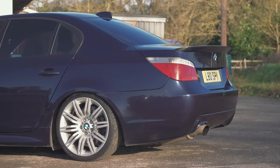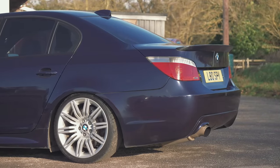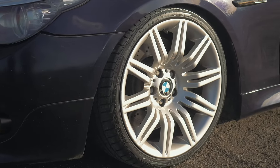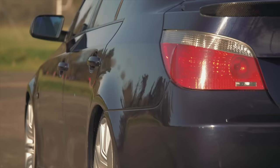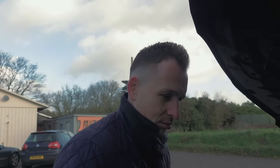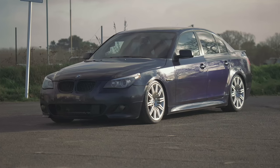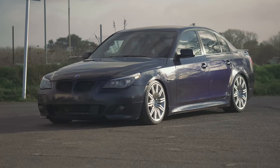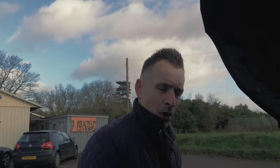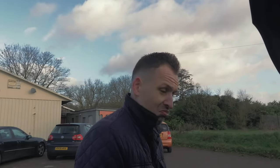Now, what about ECU mapping and stuff like that? So she runs with a standalone ECU, a Link G4 Storm, Yaris coil packs, 850cc injectors, 3 bar map, and then just on the crank, it's just a 2JZ. Any boost limit or low boost, high boost map? Nah, mate, just literally straight on. Just on the boost. That's got a custom inlet. That's got a crack in it at the minute. That's the third time it's cracked, so literally just waiting for a new one to come through the post. It's boosting about 1.4 bar at the minute. Still rapid though. Still live.